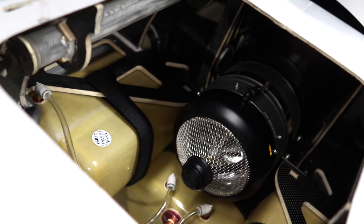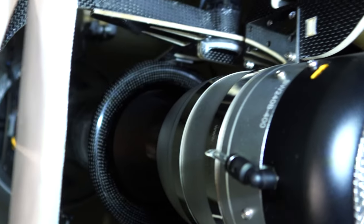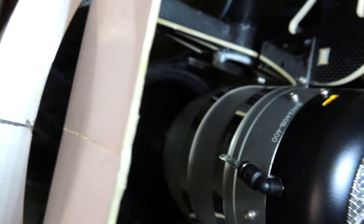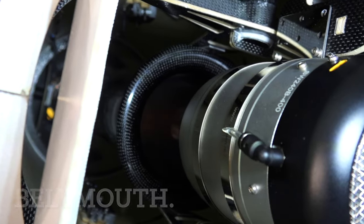We've got the pipe lined up and ended up moving it all the way forward to the forward-most hole. With the engine sitting in its home, everything lines up really well. Here's the customary view from the back showing the engine nice and centered — it looks awesome. We've got our spacing set up from the edge of the metal pipe — roughly 25 to 30 millimeters, measured from the edge of the metal pipe, not the carbon bypass. We've reached in, marked the holes with a paint marker, and will let it dry before pulling the engine out to bolt it in place.